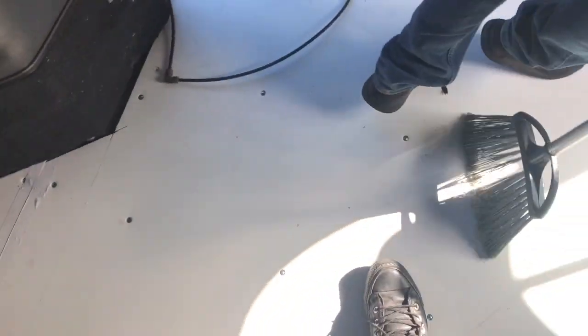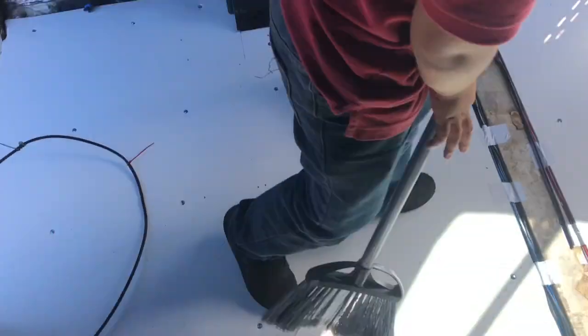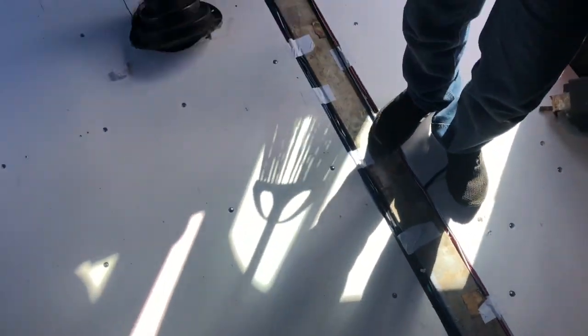At the beginning I was using the spade drill bit to drill before, but the actual PVC is really soft, so it doesn't really need it. So just step around it. I just put as many as I needed. What I did, I just step around the PVC, and where it feels like moving, I will put a screw. But now it seems that it's all nice and flat, so we're ready to put the vinyl floor.